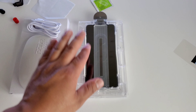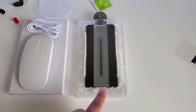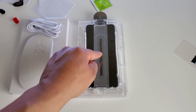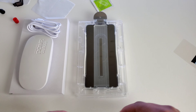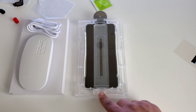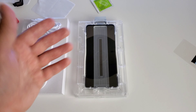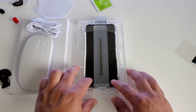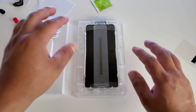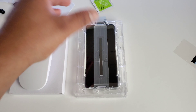This is what's holding that screen protector from falling down and landing on that adhesive. How this works as a guide — you can see there is a little circle right here in the middle. What we're going to do is apply pressure down at the bottom, let that adhesive run down right to that middle part, and then once it does, we're going to pull this top piece out, let go of the pressure, and then that adhesive will spread evenly among your display. Make sure you do this on a flat surface. I'm going to apply pressure to the bottom — just like that. Once it gets to that circle in the middle, there we go. You want to give it about a minute or two, make sure it spreads evenly all throughout the display. It kind of slid down a little bit so you can kind of push it up — adjust it yourself if you want. You really want to make sure that you do get it centered. I'm going to wait about a minute or two and let it spread.